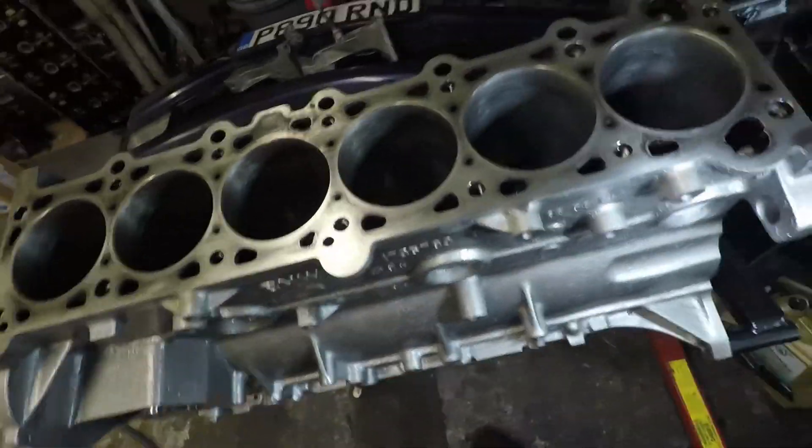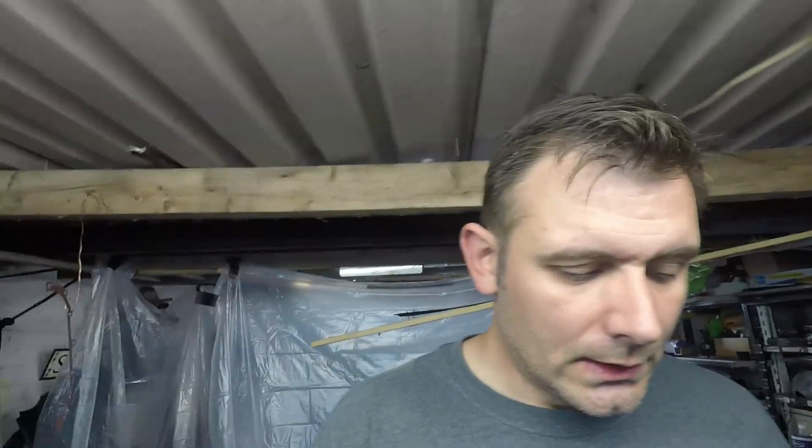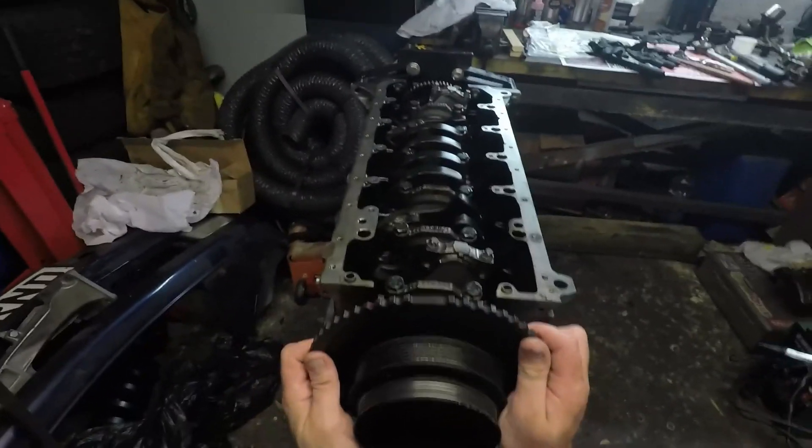At the moment it's Monday. I've given all the threads a chase out but I'm still not happy with how clean they are - going to work on them more. As soon as I get the oiljet squirter from BMW, which I believe is tomorrow, I'll get the oiljet squirters installed into the bearing ends and then start putting this thing back together. I'm also waiting on new main cap bolts. A couple of observations - things you need to know if you're doing this sort of swap. Tomorrow we get the oiljet squirter around lunchtime, probably start putting this together Wednesday morning.